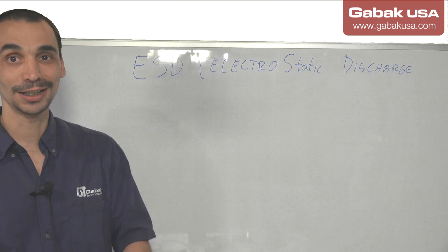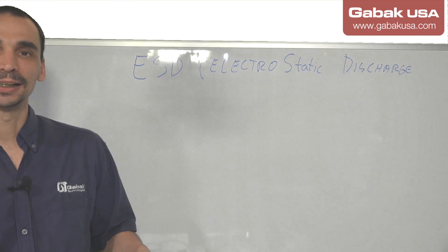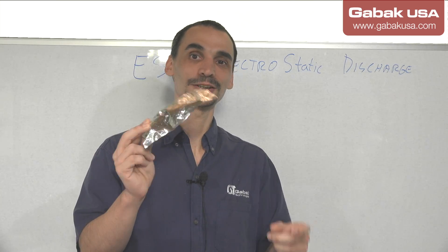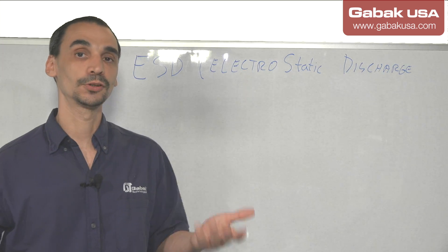There are also many other things on the market. Maybe you can find gloves, or another kind of gloves. Also, when you buy a memory RAM, a motherboard, or something like that, you are going to see these kind of anti-static bags. These bags are for that purpose. When you remove a component, always put it inside the bag — not on top of it. That way you will prevent any discharge of electricity.